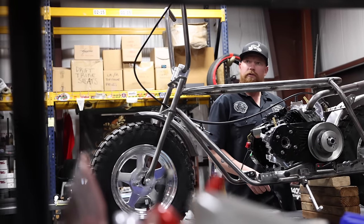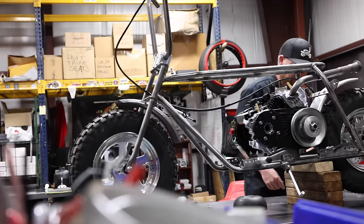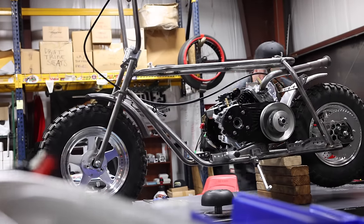So after Honest Abe, we were close, but we still needed to add strength and cut weight. We used a thinner gauge wall tubing, then added dual down tubes and took out the single tube. We have built some awesome minibikes in the past, but we wanted this one to be even better than all the raffle bikes. So a lot of these parts we took to J&B Chrome — he did tons of show chrome and tons of polishing.